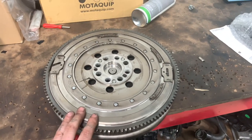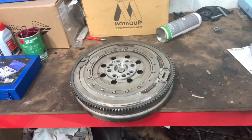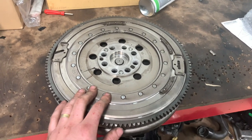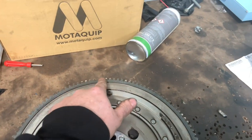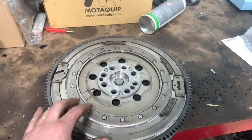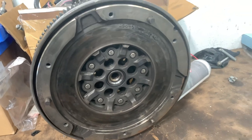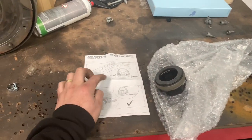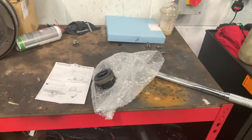On this job we're also doing a starter motor. The reason we're replacing the flywheel, starter, and clutch is because a clutch was fitted in October but wasn't installed correctly. It went to a main dealer and they said it was just a battery, but I noticed all the flywheel teeth were damaged — the starter was turning but not engaging because the teeth were worn out. As you can see, the clutch wasn't set properly and it had been burning the flywheel.